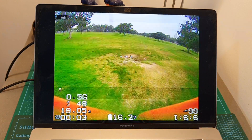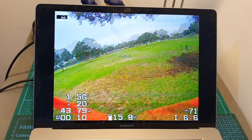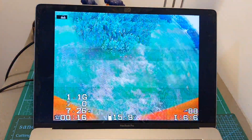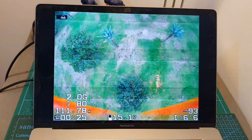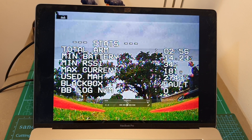After making sure that everything is configured properly, I headed outdoors and tested the Wind 5 with the new FD435 stack using 4S, 5S, and hopefully 6S batteries. As you can see, the flight with the 4S battery went pretty well, and on a side note I can tell you that so far I'm pretty impressed with Betaflight 4.1.1. Fast forwarding to the end of the video, the maximum measured current was 181 amps, which is way higher than expected, and the used capacity was 2743mAh from only a 4S 1500mAh battery.